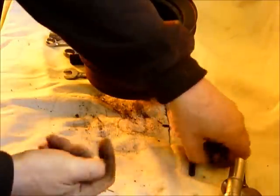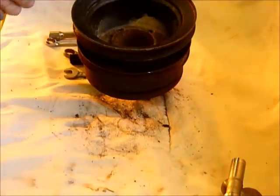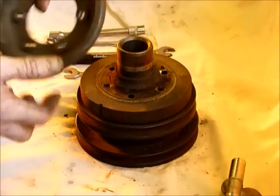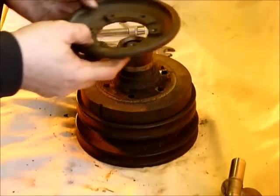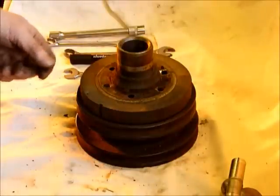This now gives you six bolts which are no longer used as they won't be long enough. Turn it upside down and remove the saucer shaped plate. This sometimes has a nasty little dust shield on it which can be removed and thrown away as well — you don't need either.